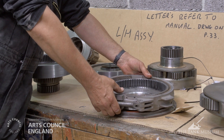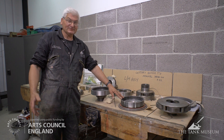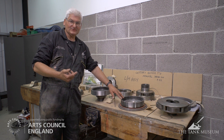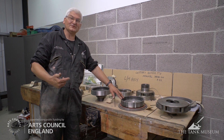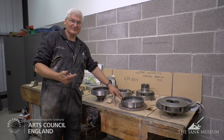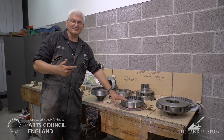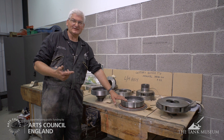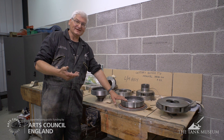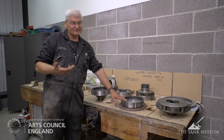That's basically how all pre-selector or epicyclic boxes work. Gear selection is done via an air system as well. A pre-selector box doesn't have a clutch. The term pre-select means you can select the next gear you want — whether up or down. Say you're in first and you want to go into second: you select second on the gear selection lever, and when you're ready to change up you press a change pedal which disconnects first gear and almost instantaneously reconnects second gear using a brake band. It's a very smooth operation in the Matilda, reducing driver fatigue considerably compared to a conventional crash box. It's a heavy tank, so the idea was to make it easy for the driver to drive, though the downside is a more complicated gearbox.